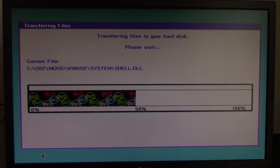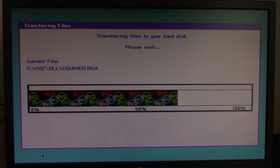Oh yeah, fixpack installations. Fixpacks were distributed by IBM in a couple of different formats. One was as a collection of disk images, which you had to download, extract each disk image to a floppy, and then run the updating setup program from the first floppy, and it would prompt you for the rest. And hopefully your downloads weren't corrupted and your disk writing went well and didn't corrupt the disks, and everything worked perfectly. That was one way of doing it. You always had to have at least 10 to 17 floppies lying around to do that, because that's how many floppies it took.